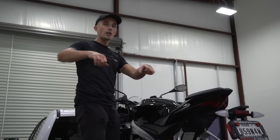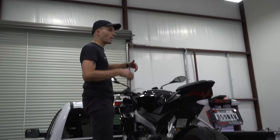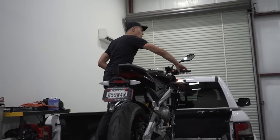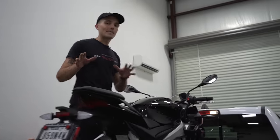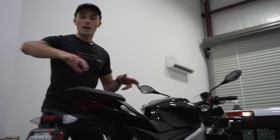Now, you're gonna pull on this motorcycle to release it from the front chock. That can take a little bit of energy and effort, and you're gonna wanna feather the front brake while you do that. That way the bike's not gonna be going anywhere. When you yank on this motorcycle, the last thing you wanna do before you have full leverage over it is have it just careen down the ramp. That's not gonna be a good time.